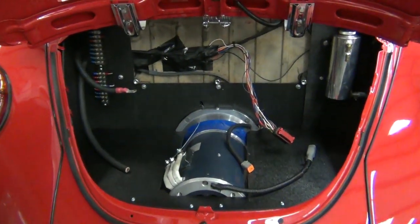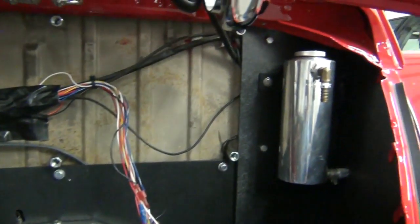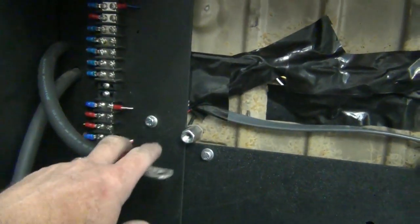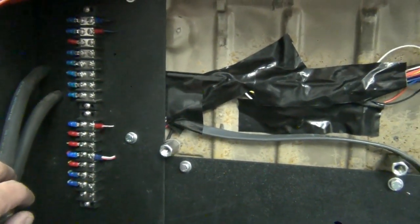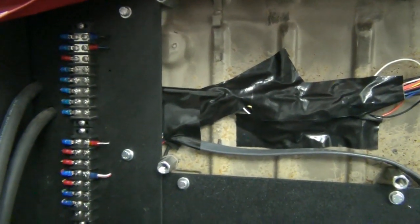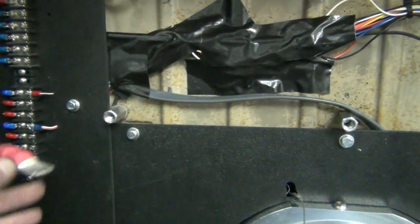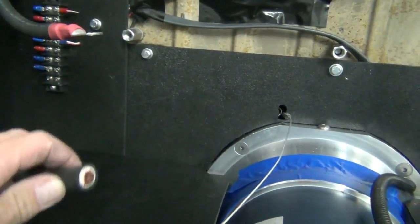Here's the bug ready to receive the component board. We've got our AC51 installed and our coolant reservoir. We have the original terminal strip that was here, and because the AC system uses a few more wires, we've added an additional terminal strip. We had one left over, so we've got it already wired. This is the positive that will go to the main contactor and this is the negative that will go to the shunt.